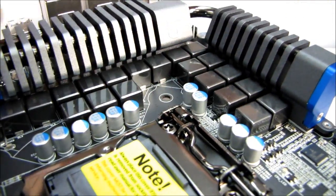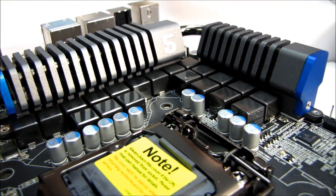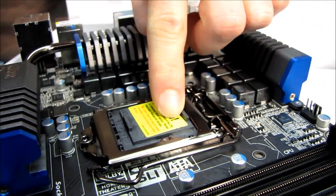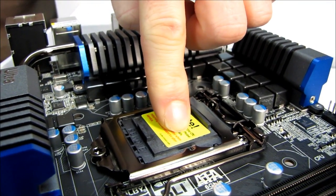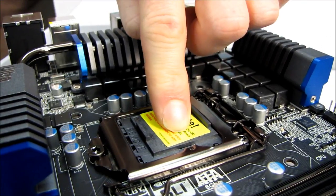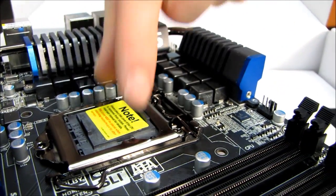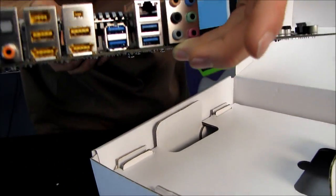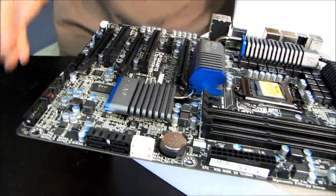The cameraman is having a look at the 20-phase power right now, as well as the cooling on the VRM and the chipset — we have heat pipes connecting all those different coolers. We have our socket right here in the middle. This is an LGA 1155 socket, so you've got support for the ever-popular Core i5-2500K as well as the i7-2600K. Anything on an 1155 socket will work here, but bear in mind this is a P67 board, so there are no display outputs on the back — you will not have onboard video support and will need a dedicated graphics card.